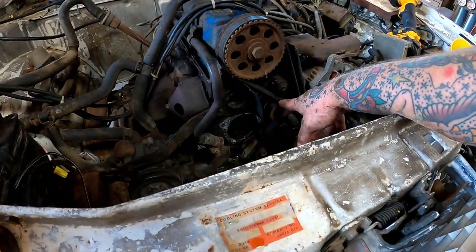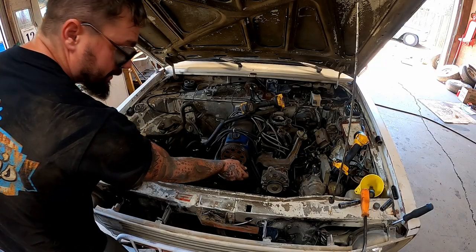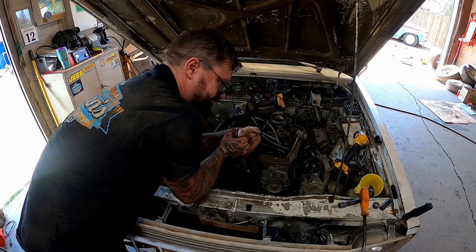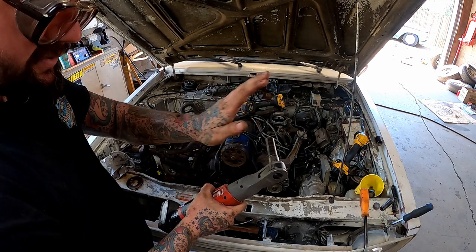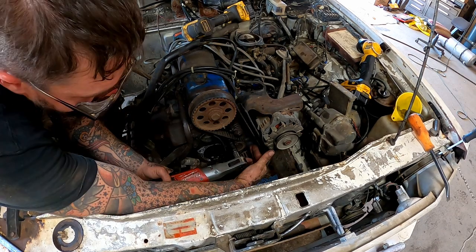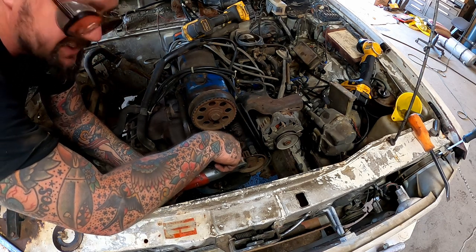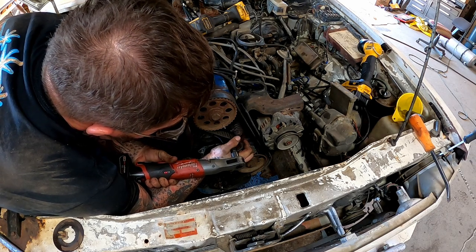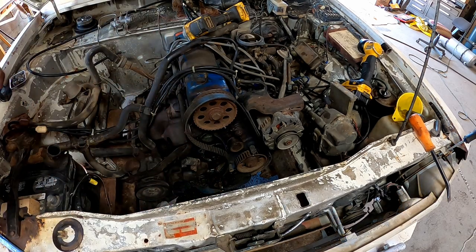So, here's how I get tension off of this myself. We're gonna find us a socket for up in there. I think she's a 13. Then our tensioner here, she's a 17. What works for me is using the old wrist saver. I put that on there where she's ready to tighten up, and you grab that tensioner and you squeeze that, and when you get it off the belt, then you tighten that and it'll lock it in place. About like so. That'll hold it where you can slip that right off.